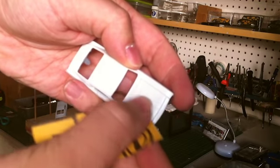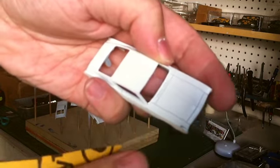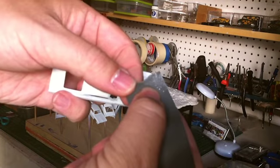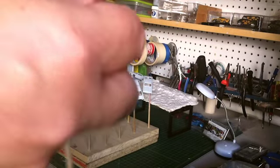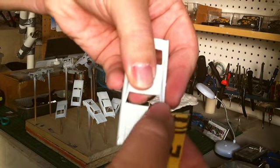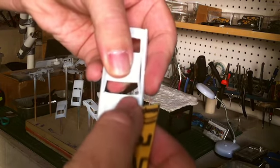And it's a really light pressure. It's just enough to knock off the grit. See there, I knocked off some of my primer. That's what I mean. See how it balls up there on the sandpaper? It always knocks the primer off when you do that. So we'll just go back in. It's just primer. I'll just touch it up.